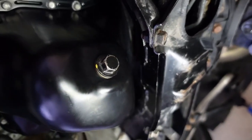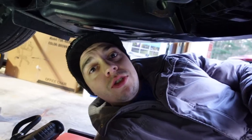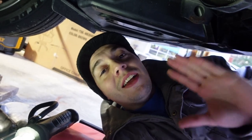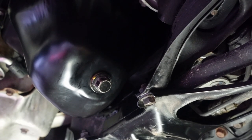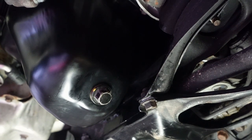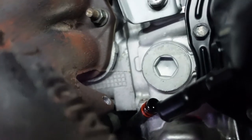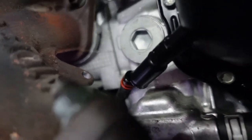You can't see it and it was hard for me to see too — I had to feel it. If I did not jack up the transmission and unbolt the engine mounts, I would have never gotten those bolts in and out back there. I just want to show you quickly how tight of a gap it is if you don't raise the engine — you'll never get it. I almost forgot the dipstick — a little bit of oil on the O-rings and it should slide right on. Push it in from the top and she should be good.